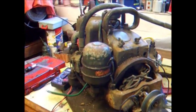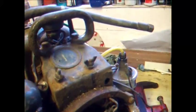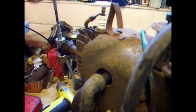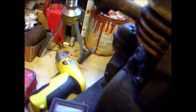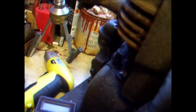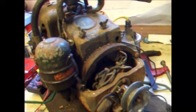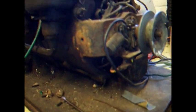That's the latest project — it's definitely going to take some work to get it going and clean it up. If I could get this cowling off and the head off and grind the valves in, it could probably be a runner today, but I want to strip the whole thing. The barrel comes off, it's all really nicely made. It doesn't look like we have a detachable sump though, so we'll have to do some cleaning through the small hole provided by taking the barrel off.